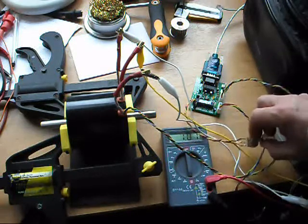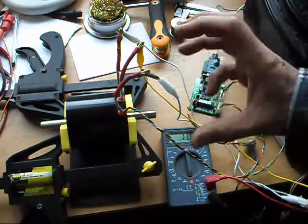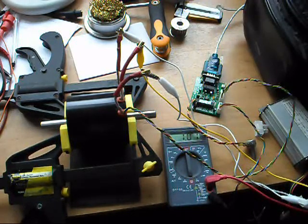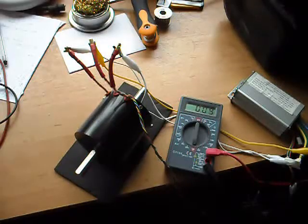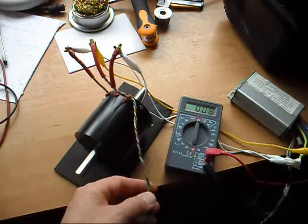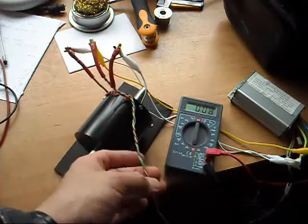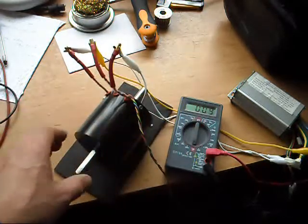The optimum is when there's no timing shift applied by this gizmo here, which means we've got the back plate in the right place. I'll turn it off and put a couple of blobs of glue on it now to hold it there for good. Here it is all fully assembled - there's the sensor cable coming out of one of the grommets. I've removed all the timing electronics to prove there's no trickery.